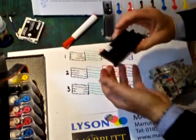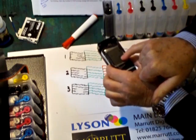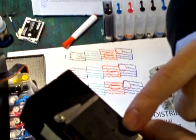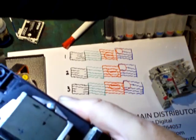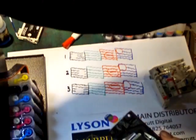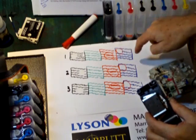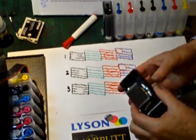It's usually dried ink underneath the cartridge. This is an ink head, and this is the underside of the ink head - you've got little bits of dried ink underneath there. That little bit of dried ink adjacent to a group of nozzles will actually do the damage. That is the thing that actually causes either a stubborn interruption to your ink flow, or a skewing of the nozzle where the jet is just slightly distorted in the same place each time. It's all down to dried ink.